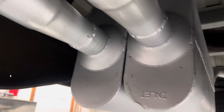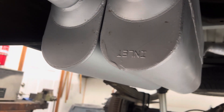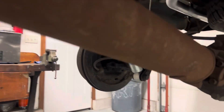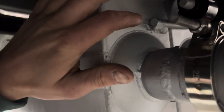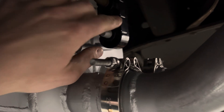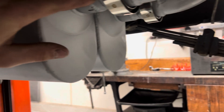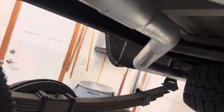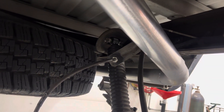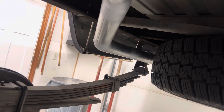All of the joints are coated. The mufflers were sandblasted and coated, and then after they were sandblasted and coated they were welded together with a hanger and hung at the factory hanger location. They reduce down to two-and-a-half inch and then go out the back individually on each side — here's the driver side and the passenger side.